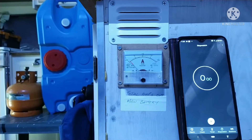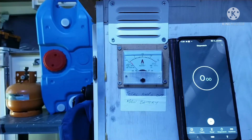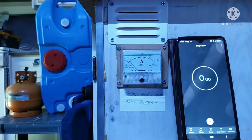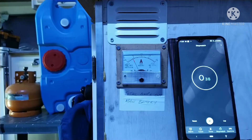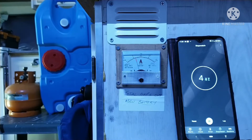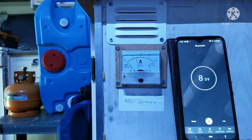You can see the amp meter is showing about one amp — that's because the cabin lights are on and the phone I'll use to time. The glow plug will now start heating up. You can see the needle rising, so we'll put the timer on. It's going up to about six, seven amps.